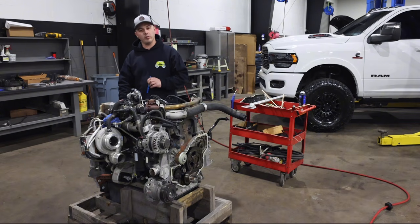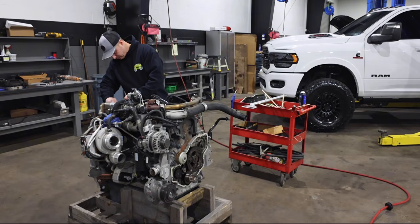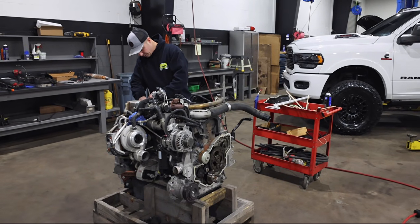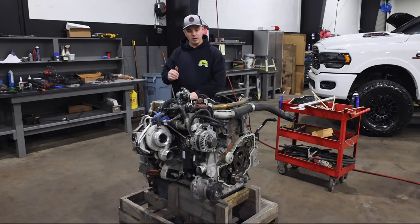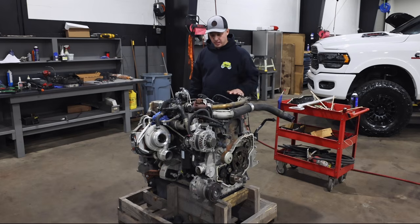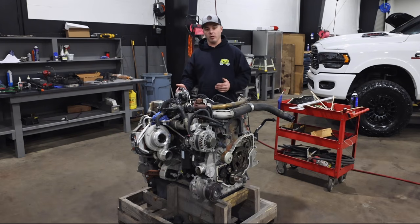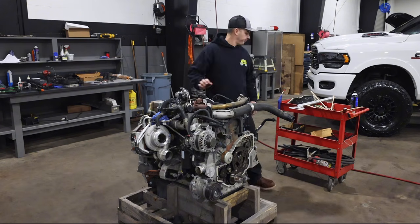And I'm in the first one. I already feel it pulling right up to where it stops, and we'll just use our clamp to get in here and pull it up. Clamp it and push down a little bit so that way it's resting all the way, and it keeps it right at the very top. And we're just going to go through and pretty much repeat that process for the next 11 of them, and we'll ensure that all of them are all the way up, and then we'll be ready to pull the cam.